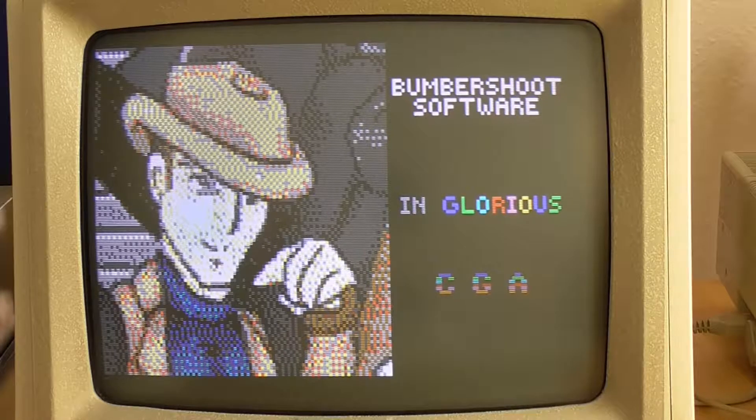What you're looking at now appears to be a 16-color CGA graphic, but this is a little misleading — I'm actually using a text mode here. Although the text modes are 16 colors, you can also set the size of the characters being displayed. If you set that to a very small size, the characters look like little dots on the screen. The disadvantage is that you only get a resolution of 160 by 100, which is half in each direction compared with the CGA color graphics mode. So you've lost a factor of four overall but only gained a factor of two in color — going from 4 colors to 16, or from 2 bits to 4 bits per pixel. So this is really a cheat.